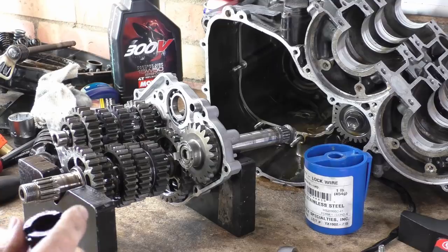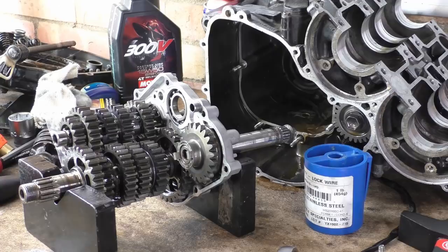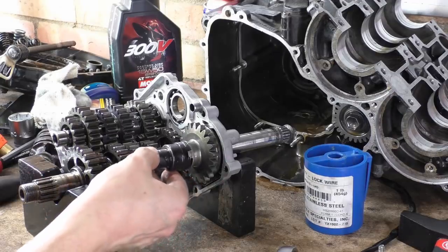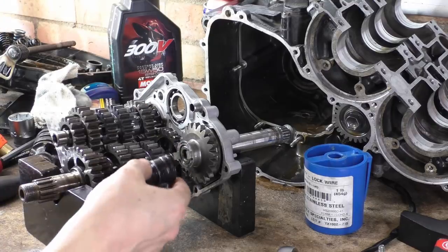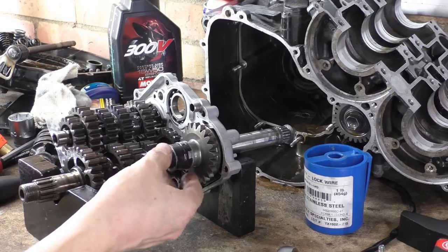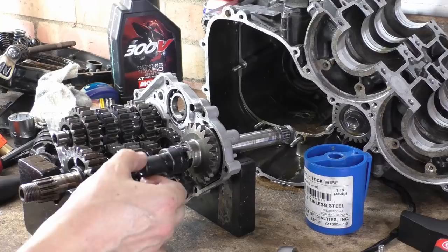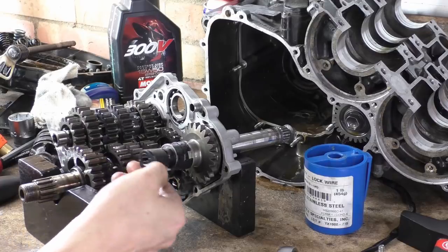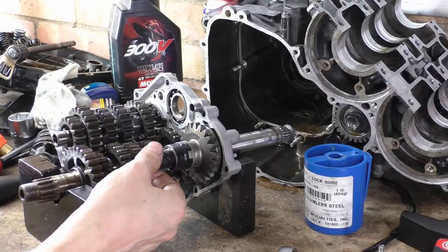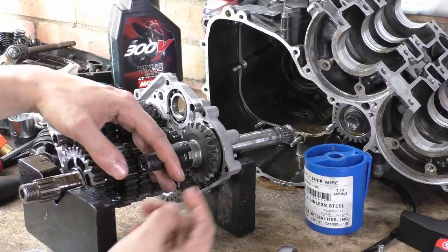And this is, for all intents and purposes, I'm sure glass reinforced plastic. I don't really want to take a chunk out of it just to find out, but it feels like it is. Why has this got a plastic drive? Basically, there's a blind boss inside the casing. This is so if this goes wrong, it will wreck this in the housing and not the housing, so the plastic will yield and deform a lot sooner than anything. It's basically a snap away section, so this is held in like that.